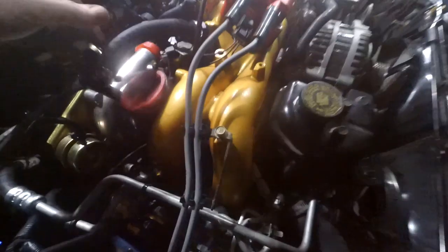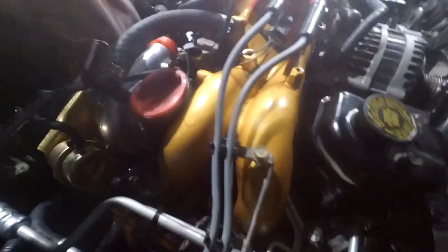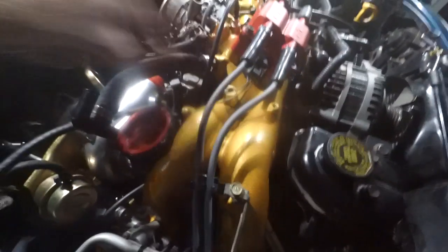I just got my boost controller stuff set up in this F pipe here. So this is the crankcase. You can see how tight this stuff is. It's ridiculous, but I got the F pipe sitting right here. Hose clamps are tight, so the PCV goes to there, and this will go to my catch can. I got my boost control set up, so basically it goes into here, T's right there. And then it goes to the boost controller right here, which is turned all the way down. I'm pretty sure I have this hooked up correctly, I think.